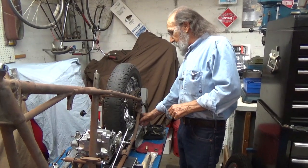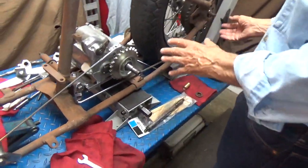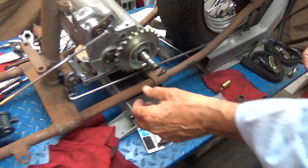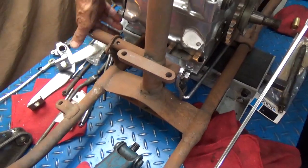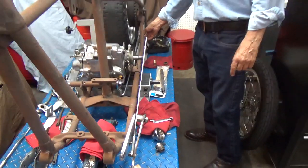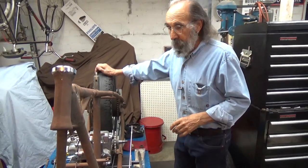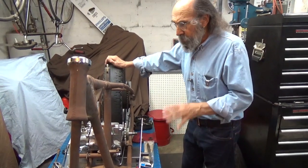I've been coming up with linkage for the rear brake. I'm probably going to replace this old beat-up rod, but by getting it in place I see everything that I'm going to need. In the last video we showed the cross shaft for the brake. You can see now how it functions — by pulling a little lever on the right side with the brake pedal, it moves the shaft which moves this link, which pulls this rod and this arm, which actuates the rear brake. I'm just trying to get all those things in place even though I'm probably going to replace most, if not all, of them.